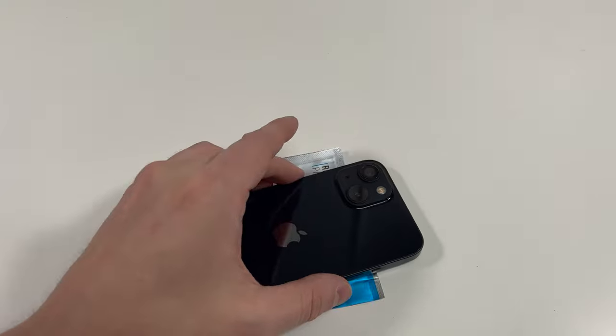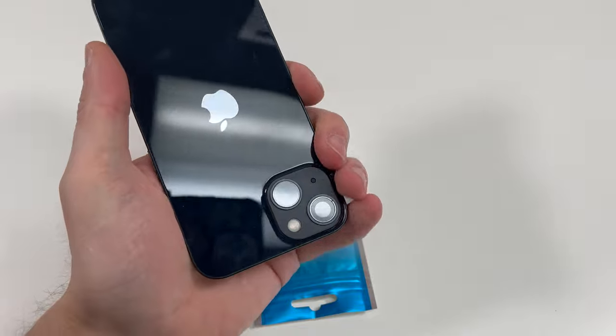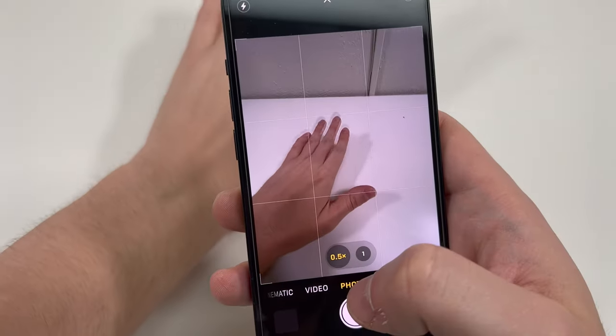The last thing I want to do is clean the actual camera glass that we're going to apply and make sure there's no glass in the actual camera sensor area. Then we're just going to set this on here — you can use your finger, it doesn't really matter because you're going to clean it after. Once that's set down, the camera should look good. If not, you might have to replace that camera. But if it does, you're all set.